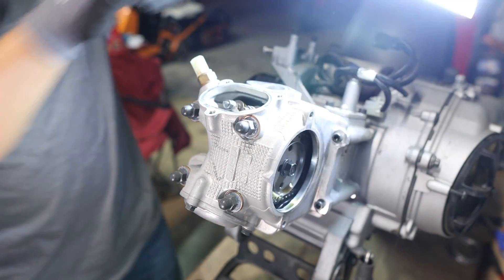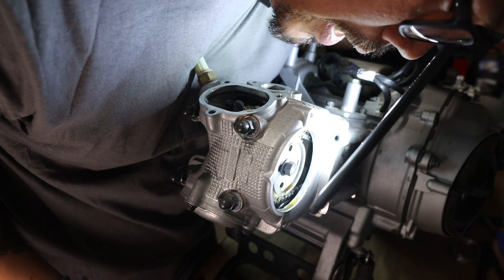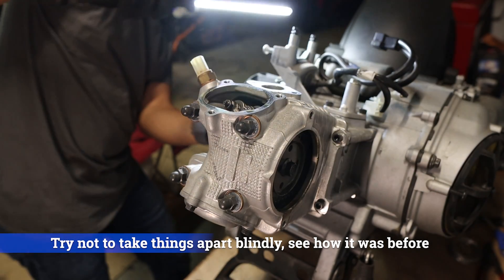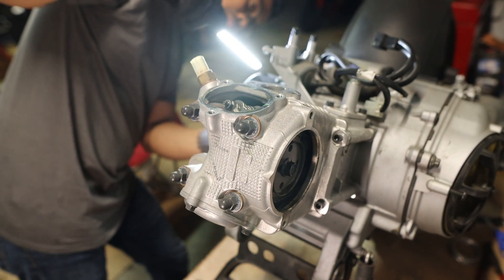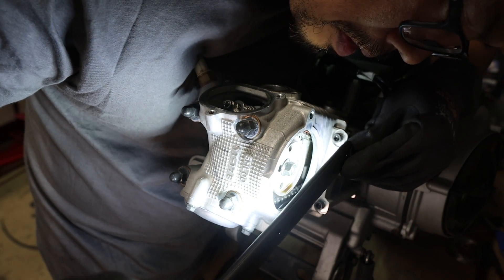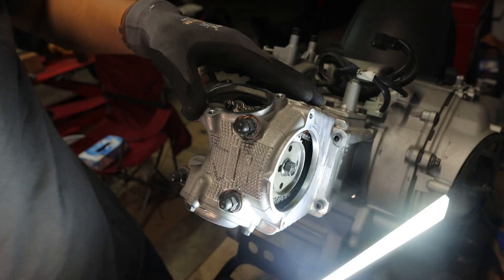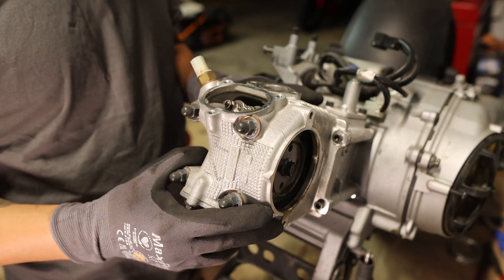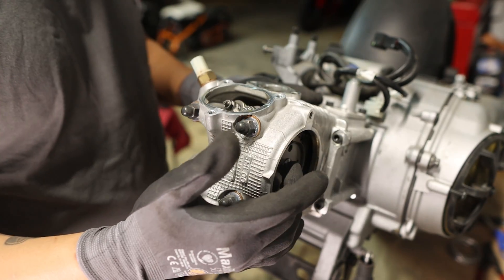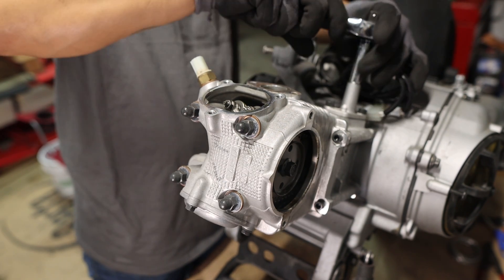I turned on some light so I can see inside. When I look in here I can see the mark for the timing chain — it's facing down. Right now I have it on top dead center, and that line is facing down. Cool. I assume in order to take this off I need to loosen the chain and take the sprocket out for the head — 10mm socket in the back.